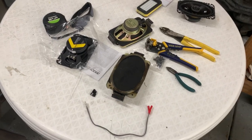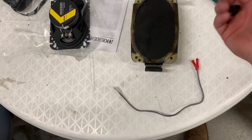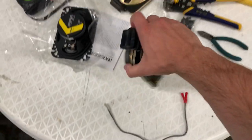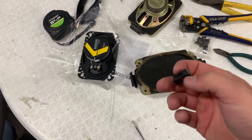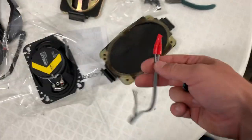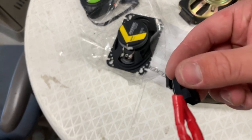I want to give you guys a quick how-to on wiring once you get the old ones out. On the truck I have already cut the wire — you unplug the connector from the speaker in the back. After you pinch that little top tab, they pull down and come out. Then unplug them there. Come over here, get your new speaker — the wires they send with it plug onto the speaker, and then you connect the supplied connectors onto the back. Then you go back over to the truck: the connector that comes off the truck is what you are replacing.